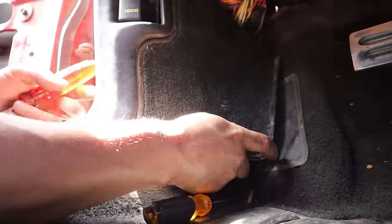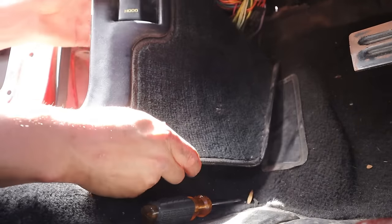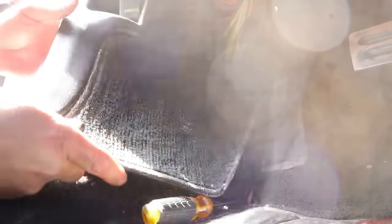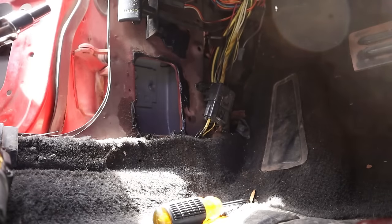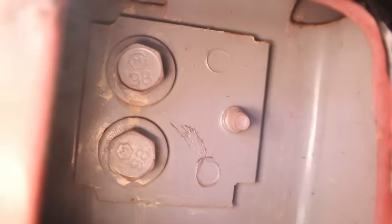Another Phillips. All right, oh, sick. The hood latch don't come with it. Hell yes. Very nice. Come on. Give it to me. Ta-da! We're in like Flynn. I don't even know what that means, but it's provocative. White people don't even know what it means. I don't know what that is, but it's hiding in there. Oh, I found our bolts. They're big. Those things look like a 17, or actually probably a 15. Remember, it's a Chevy. Yep, sure enough, 15. Get you guys in there so you see what I see. Yeah, there it is. That's our two hidden bolts, and they are 15 millimeters.